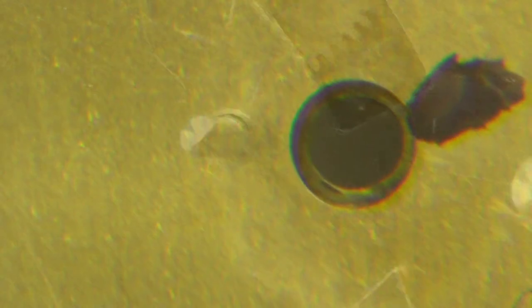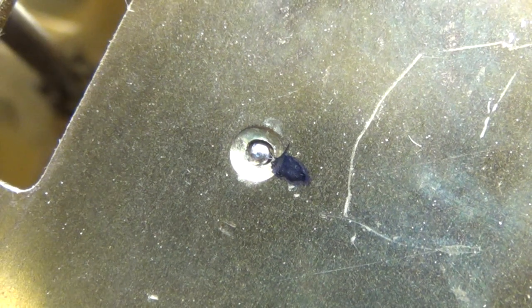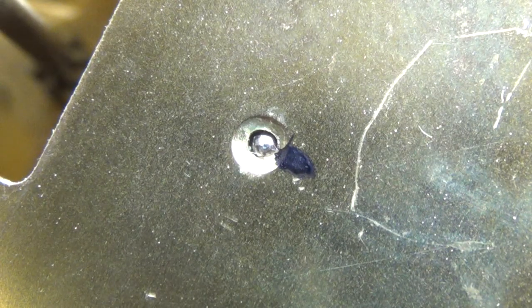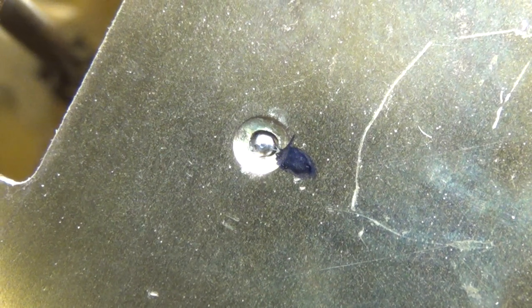Let's mark that one. And there's the hole in the back. You look toward the black dot. You can see that the rim ring around the hole, the oil sink, is thinner on the black dot, the magic marker dot, than it is on the left. So that's worn to the right. Strike side, looking at this one, I just don't like the amount of flopping around that it's doing, so we'll replace that one. The others, I didn't find anything wrong.